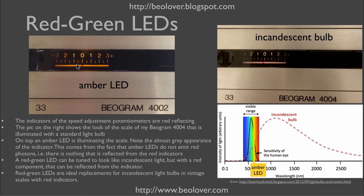The reason is that amber LEDs emit a very narrow wavelength range, as you can see on this spectrum, and this wavelength range does not overlap with red. The issue is that we need red light to reflect from the red indicators. The dashed line here shows the spectrum of an incandescent light bulb, which has a very wide spectrum covering a vast range of wavelengths.